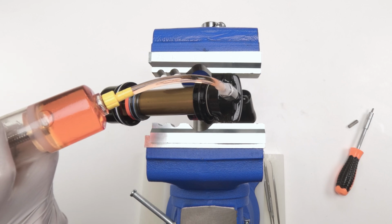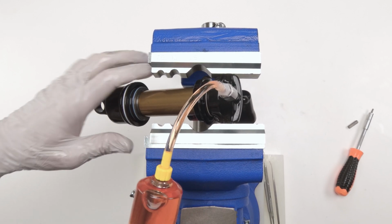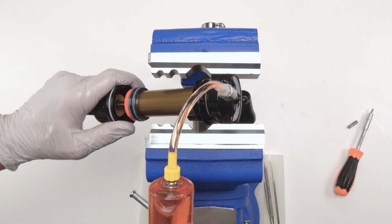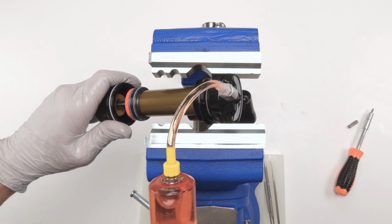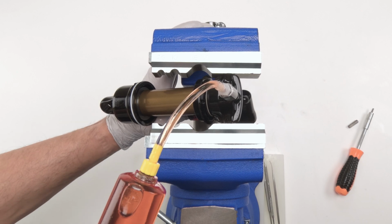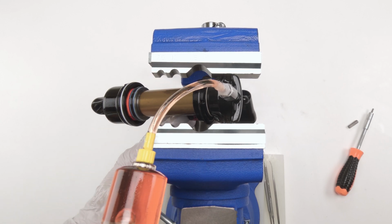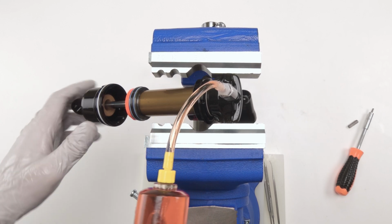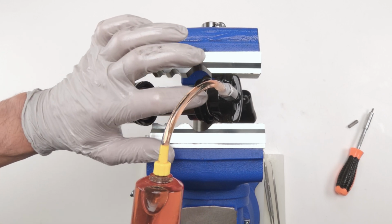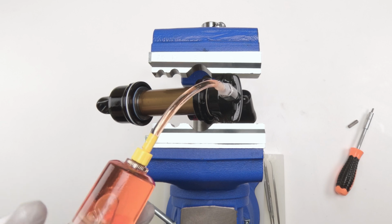All right, let's force him out again. Oh, hear that? Look how silent that is now. I don't hear any noises coming out of this side. So let's push the IFP again. And guys, take your time over here. You're doing yourself a favor. Just go over and over and over until you feel comfortable. Oh, see, there's an air bubble in there. I just heard it. So I moved the IFP. There was obviously something trapped, probably in the dials, and ultimately it just let go.